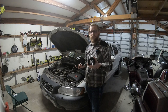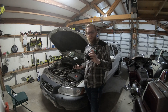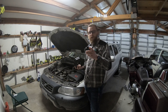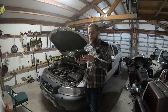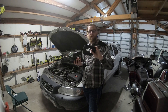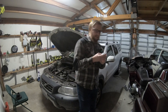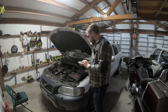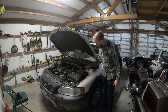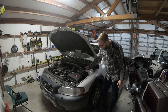We've made our way back to where I was at the beginning of this video. These models were available for free online from some other Volvo XC70 enthusiasts. These are rear spring spacers — they go just underneath the spring, pushing it up to increase your preload effectively. And these are front top hat spacers, and they go right about here. I did also have to spend about 10 bucks on these bolts, which I'm hoping are the correct ones. Considering the front is just top hat spacers, it should be a lot easier, so let's do that first — jack up the front of the car and get started.